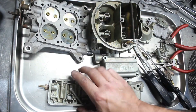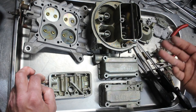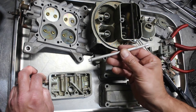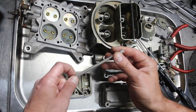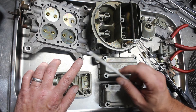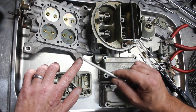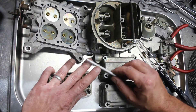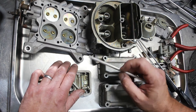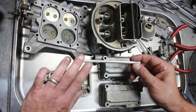You know, it's nuts. This carburetor, when I pulled it apart, looked for all intents and purposes like a fairly standard carburetor, but as soon as I pulled the front bowl off it, the first thing that stuck out to me was this: the transfer tube that goes between the front and rear bowls — one end, normal; the other end's been hacked off with a frigging hacksaw. That will be because whoever touched this carburetor either had the wrong kit for it, or didn't know what parts were in the kit and how to use them.